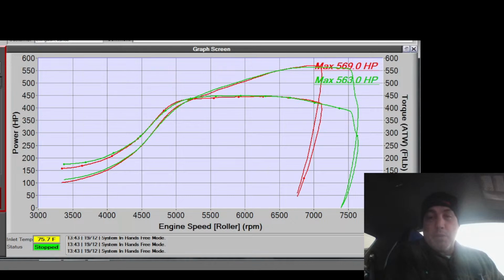The cold air. My hand is going to contact more molecules, and so in the turbo, when that blade comes around, it's doing the same thing my hand is doing. It's going to grab a certain amount of air. It's got a certain amount of surface area, and it's going to hit air of a certain density, and it's going to have to spin more RPMs to get the same mass of air in warm weather than it would in cool weather. So, absolutely correct.